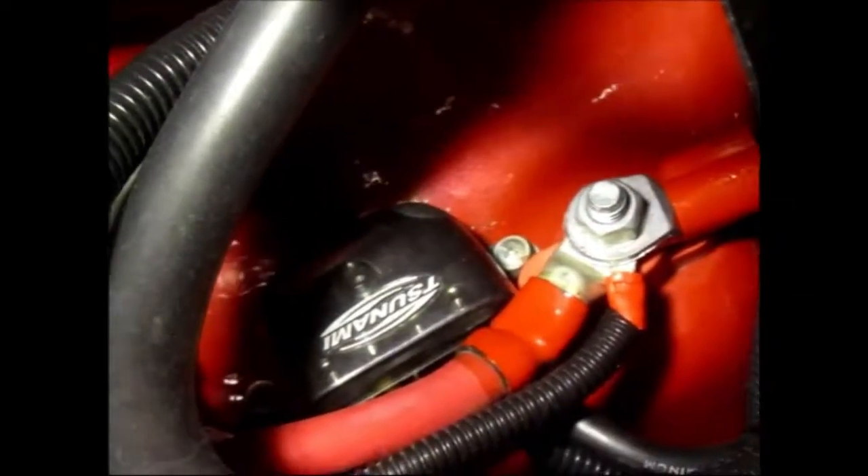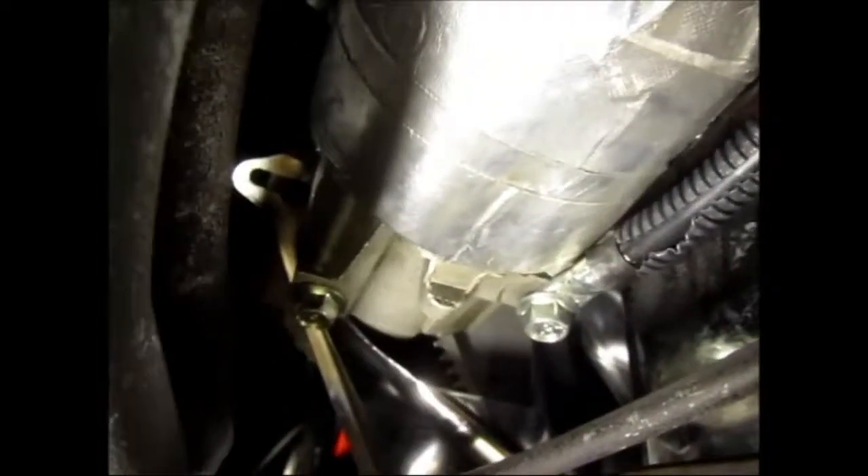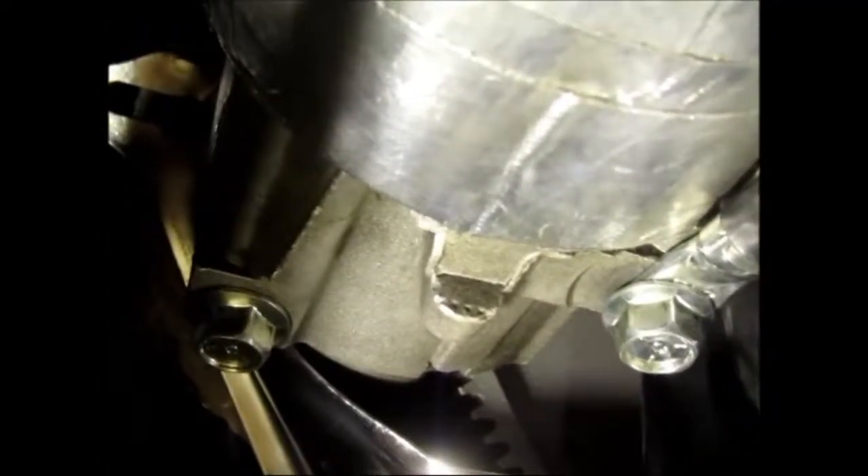You can see there's a bolt right there on the subframe. From the subframe to the engine block — because the engine block did not have a ground. I also added another ground wire to the starter: a 2-gauge ground wire going down to the starter. Let's go under the car to see that. Here's the starter motor and my ground wire — I connected it to one of the mounting bolts on the starter motor.